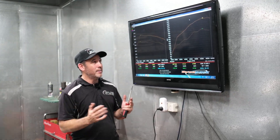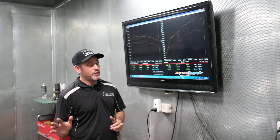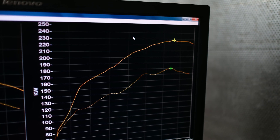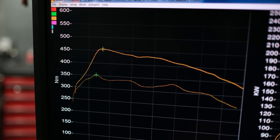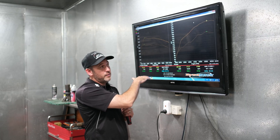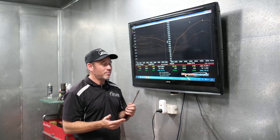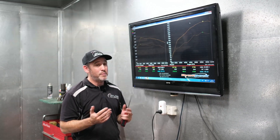But compared to standard, it's a massive difference. When we bought this thing, we ran it in and put a few Ks on it, then we did some power runs and we're getting — let's call it 179-180 kilowatt standard, and about 352 newton metres of torque at the hub. Now we're able to get it up to 454 newton metres and 227, just shy of 228 kilowatts. That's a huge difference — almost 47 kilowatts, which is pretty massive.